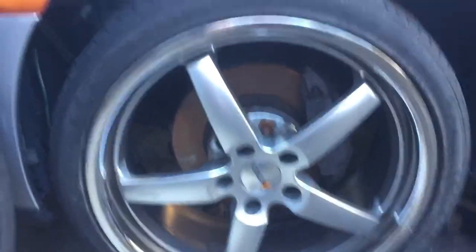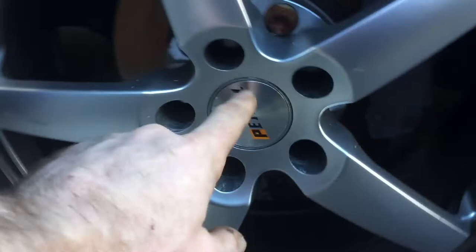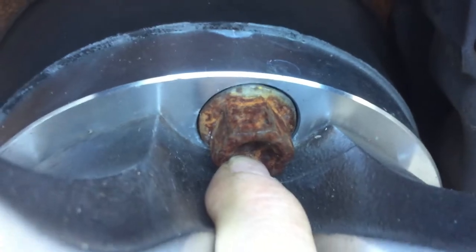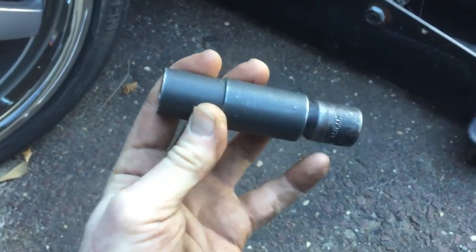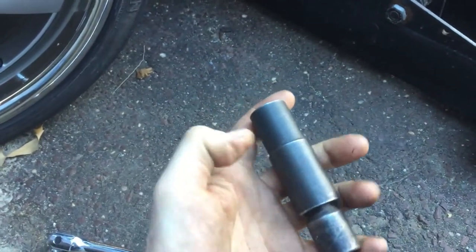This is the tire I'm going to take off because it's my summer tire, and I want to put my winter tires back on. There are nuts in here that hold the tire on. Let's go over the basic tools you're going to need. You're going to need some kind of wrench or breaker bar — I prefer a half-inch breaker bar — and the proper socket, maybe with an extension to get in. This is a flip socket, so I have to use the extension to lock it in.